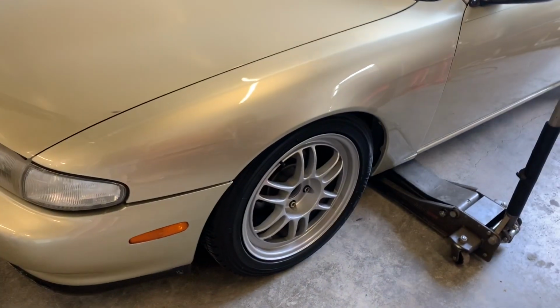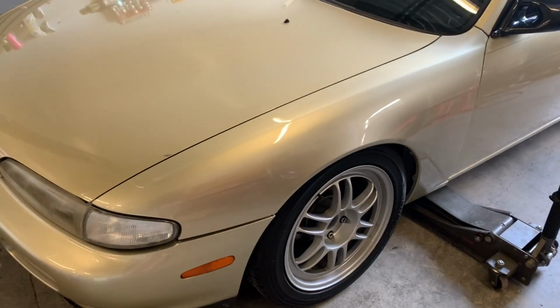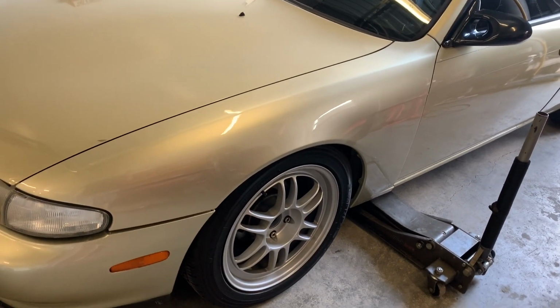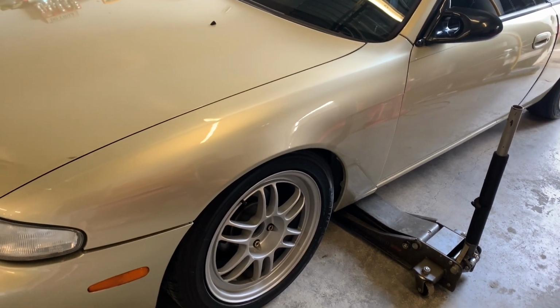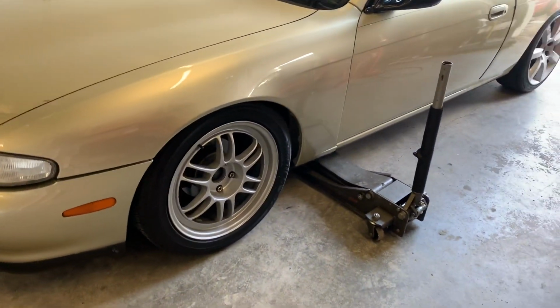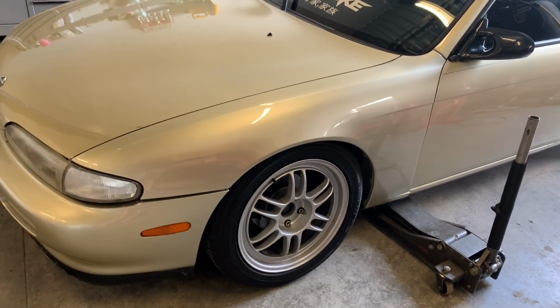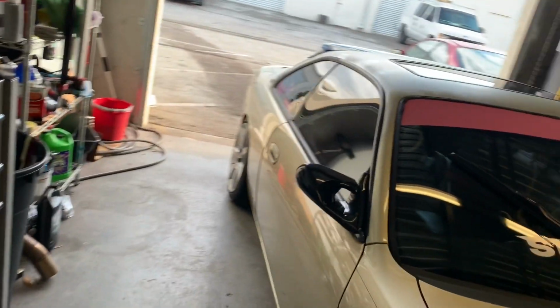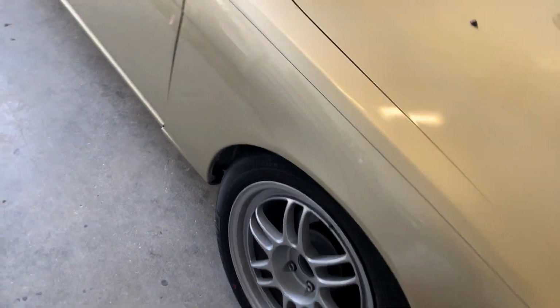All right guys, so Brian's car is all done. My car is in, Lex is back in, just doing it quick, just like I said, a quick roll, take out the camber in the front so it lasts a little longer, because I got a trip to go on Thursday with this car, so I want to have the least amount of problems. So I take out the camber, roll it, and then probably go lower a little bit. Again, the rear tires' sidewalls are smaller, those are 40, these are 50. So it's different, but you guys get what I mean. I'm gonna just set you guys up.